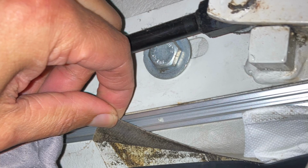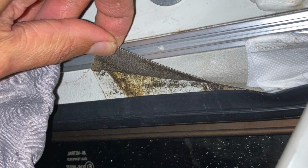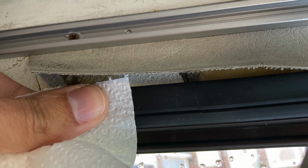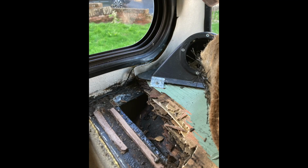see my curtain rail looks very unhealthy, shouldn't be that colour or that wet. More headlining sagginess. Pulling up some trim you can check, but it's pretty evident even without using a bit of tissue paper that this curtain rail is very wet and very rotten, so there's water getting in up top somewhere. It will leak down the side of the cab and then sit on the flat dash and rot it out nicely, which you may not see because it's covered.